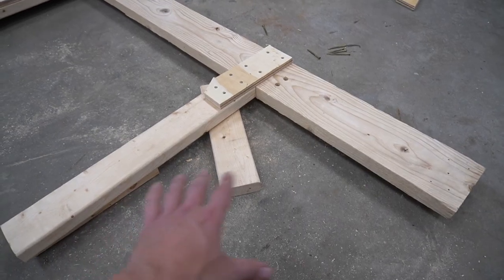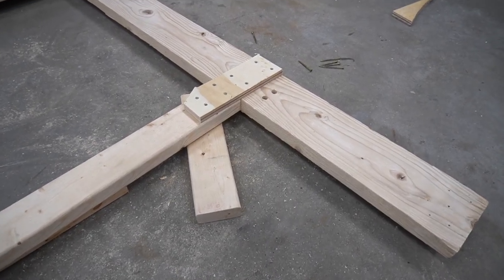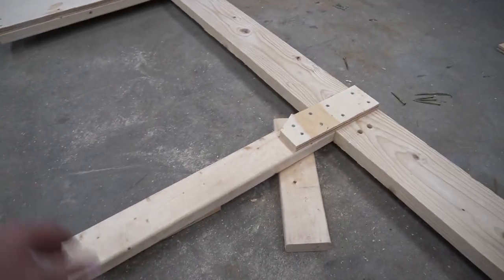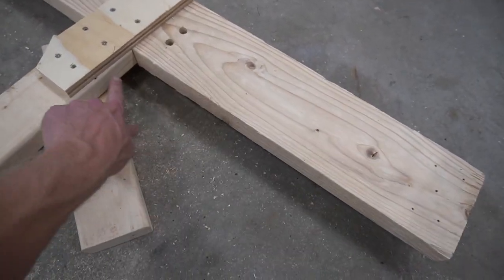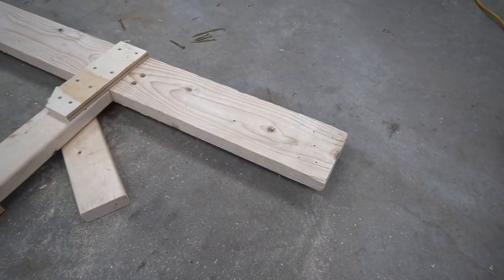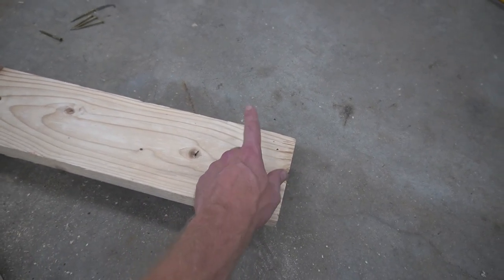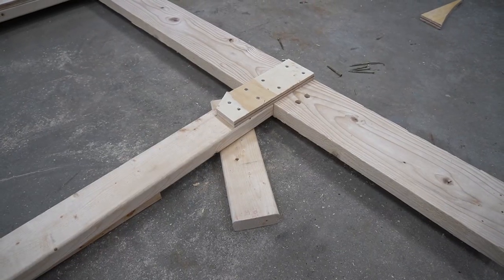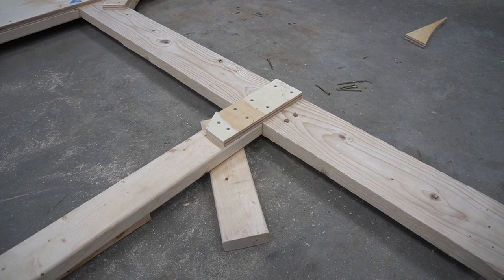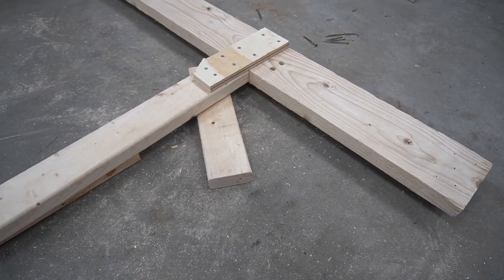Doing this will also allow me to switch or add plywood to this side and flip the car the other way. The main reason I repositioned the leg: when the car is sitting on these legs and not tilted over, I want the weight to transfer from the leg directly down to the ground. With the extra weight, I was worried about stuff breaking apart. I'm going to flip it over, use a mending plate on the other side, and then put a two-foot cross piece in.